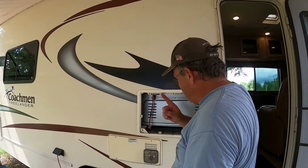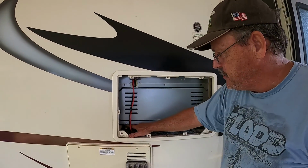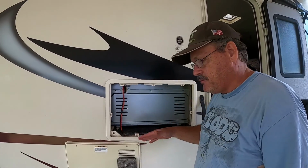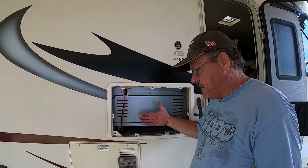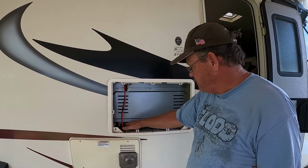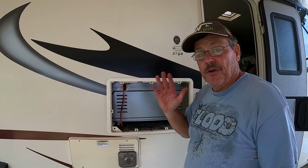All right, the cover's on. One last thing, this floor was not exactly great, so I put a shim underneath this roller to get the refrigerator nice and level in the back as well, so it didn't teeter-totter. We got the front level, but if the back is not perfectly level, just shim up the roller area and put a little glue on it just to hold it in place. But anyway, we are done.